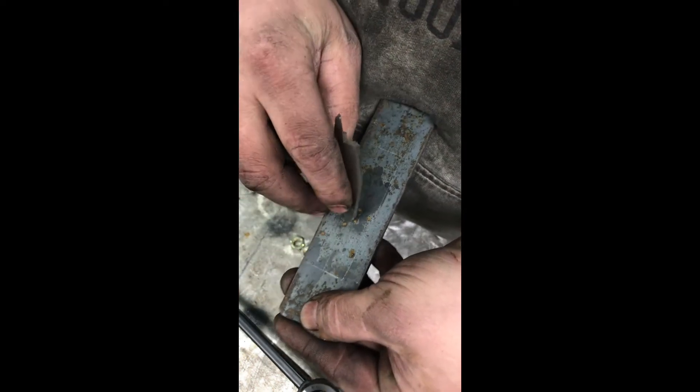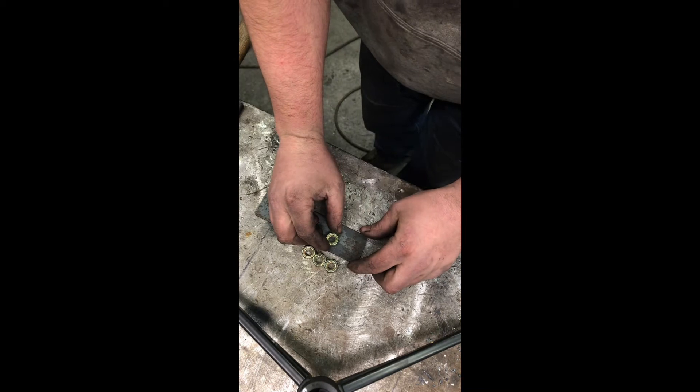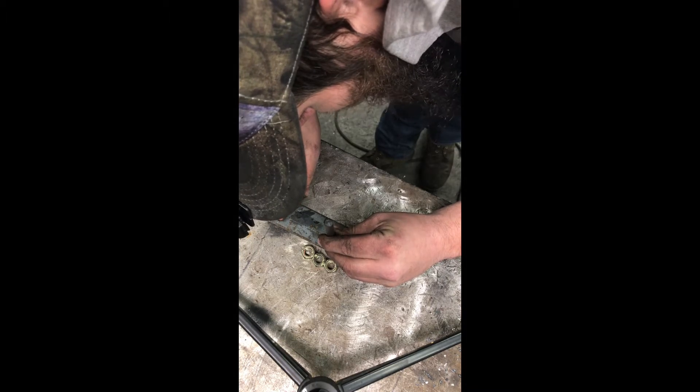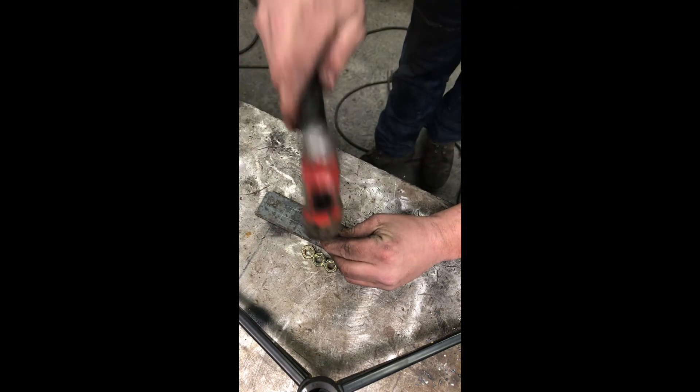There's a little piece of slag right there. So now I've got a center mark — you can see there. I'll line up one nut on the very outside edge of that, use a transfer punch that's the right size. Try not to disturb the nut putting it in place. You can kind of slide this center punch back and forth — if you've got a decent groove from your caliper it'll sit in there. Right on the mark.